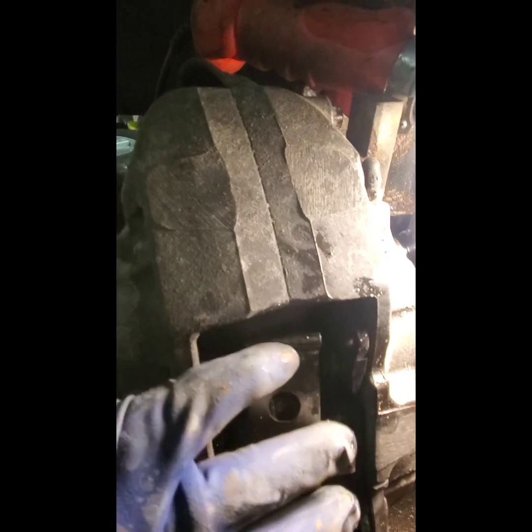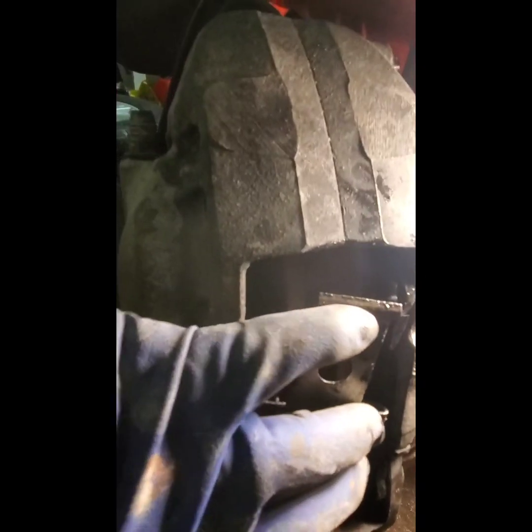Okay, so once again, we're going to slide it on in. Okay, then we take this, clean it off, put it back in. Let's see if we can drop everything. That'd be super. Okay, so your chatter pad goes in like so. You put the pins in under each end of it. So under there, and this will be under tension, okay? Actually, it goes this way, my bad. It'll be under tension. And then you put it all back together, and that's about it, okay?